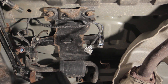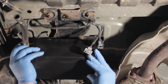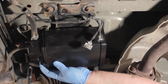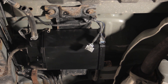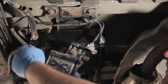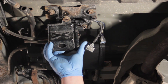Now that we've transferred all of our components, let's go ahead and reinstall very similar to how we removed it. We're going to find the lineup tabs on the back of the canister, install that, slide it into place, and reinstall the hold-down bolt on the other side. With the canister mounted in place, we can go ahead and install our new 2-way valve, bypass solenoid, and pressure sensor. We've just got a few hoses to connect, and we will make our electrical connections and mount it back in place, making sure to use the original rubber grommets.